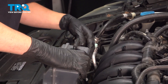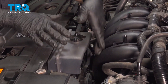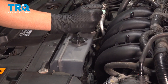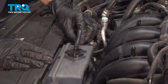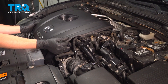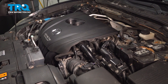Let's slide the overflow tank back down. Make sure this wiring harness is out of the way. Once it gets seated in here, it's going to have to click into place to lock in — so tap it on both ends. You should not be able to easily pull it back out. Also make sure it's flush on the bottom. Then reconnect the hose to the radiator. Reinstall your engine cover — line it up with the oil fill cap, the dipstick, and the four pins. Press it on and make sure it's secured. Turn on the engine, make sure it runs right. And there you have it — take it for a road test.